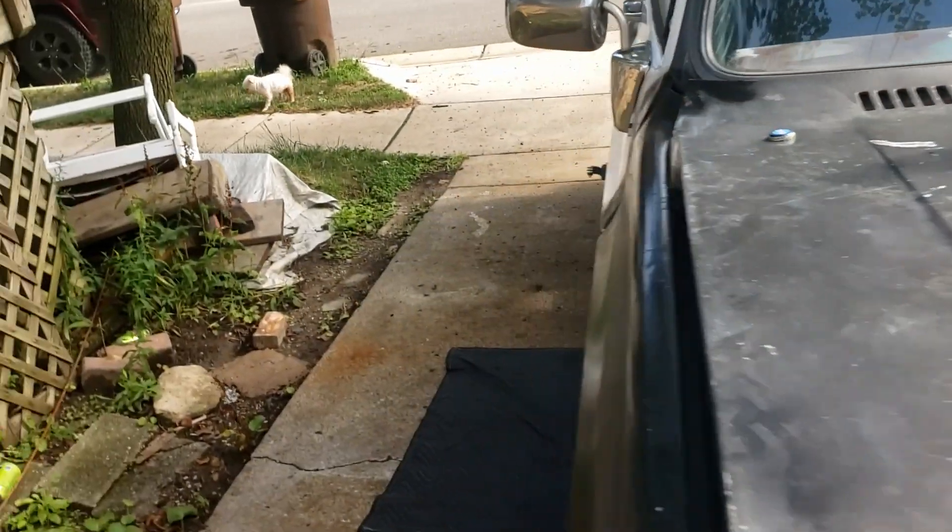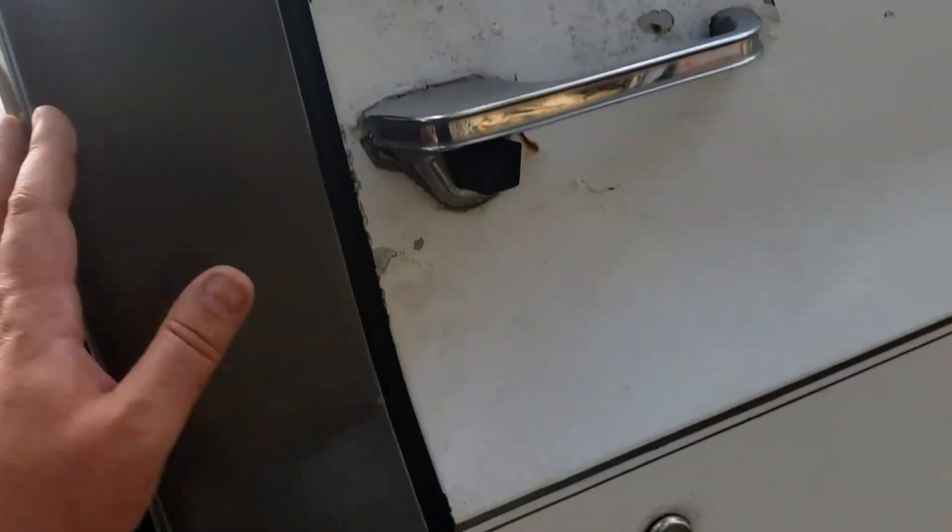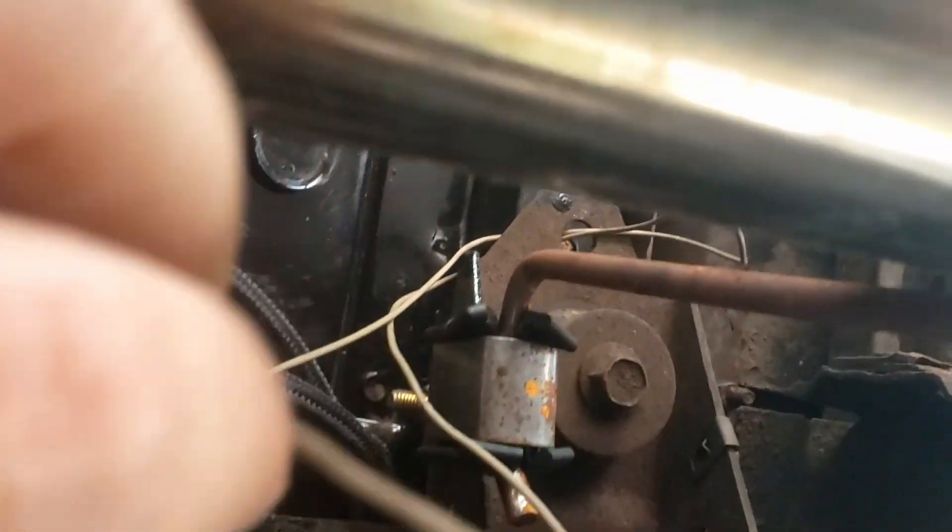With the help of the group and some smart wiring guys, I was able to climb underneath and figure it out. What I found was that my gauge didn't change no matter what I did. I'm using a Speedway harness, so that tan wire is my gauge feed to the actual dash and runs directly to it. The black wire is the ground.